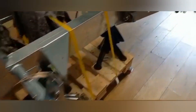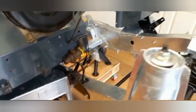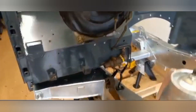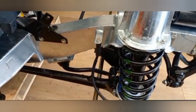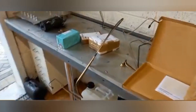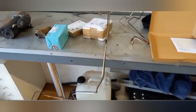The actual ones will be the right length — that one runs all the way up the chassis into this valve, so it might be different. When it runs over the top, because it has to go via the valve, I might have to alter that — I might have to buy a real brake hose. We bought a kit, and I'm just going through some of the brake pipes against the originals. I need to adapt a few of them, but that'll be okay — we'll make it work.